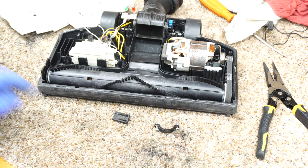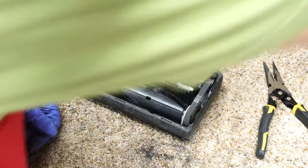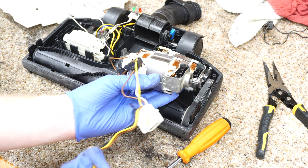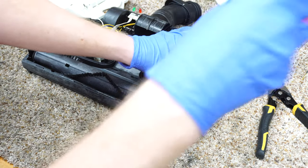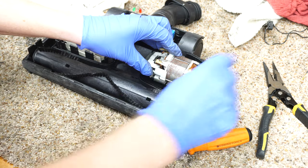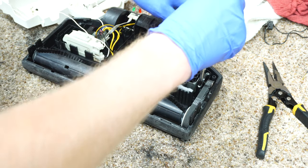Now we have the wedge, which looks like a Miele upright if you've ever worked on one of those. Actually the Miele upright was based on this sort of design. If I grab a Miele upright motor — I happen to have one — I don't think you'd be able to tell those two apart if I didn't tell you. Notice I'm not using a drill for this section — we want to use our hands. Before we tighten anything, notice it's kind of loose — we want to put tension on that belt using the wedge and then tighten down. It is easy to strip these screws or break this plastic motor holder, so keep that in mind.